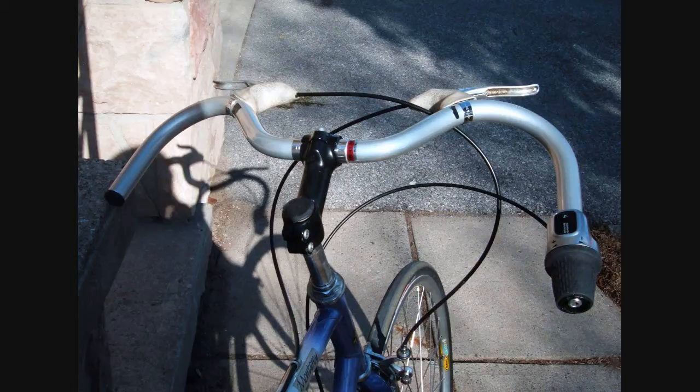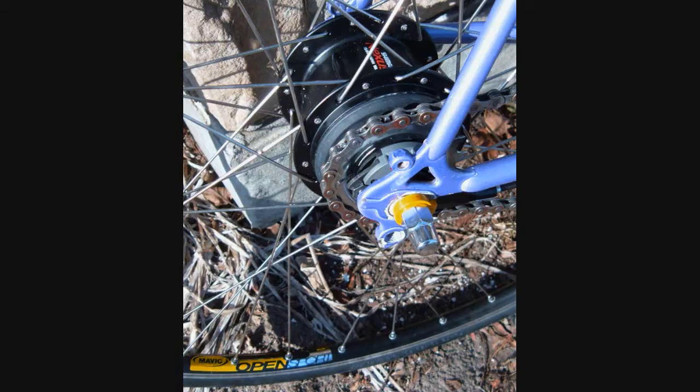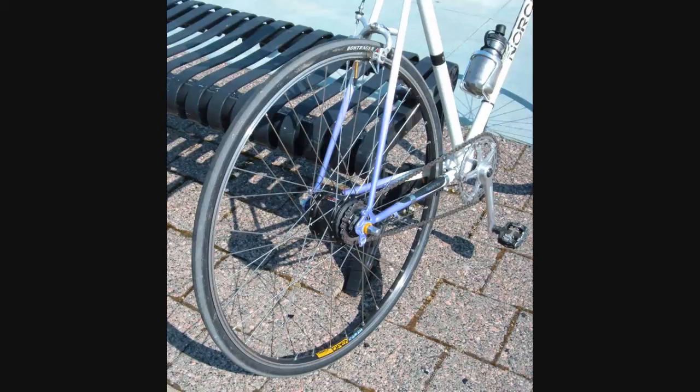In addition to supporting my camping adventures, if things were satisfactory I decided to evolve the bike into an all-weather, all-season general utility bike. I therefore released the purse strings to realise a long-held ambition and ordered an 8-speed Shimano Nexus internal hub. The installation required spreading the rear dropouts by about 6mm, using the method described on Sheldon Brown's website on the subject of frame spacing — it's quite straightforward.